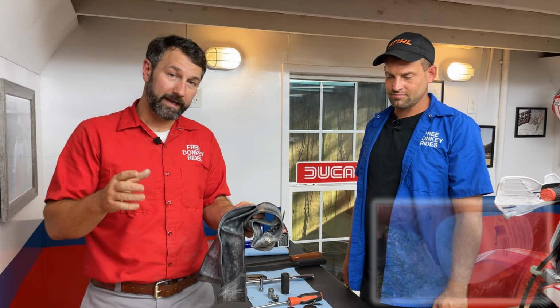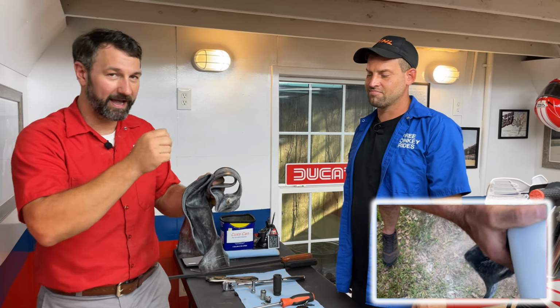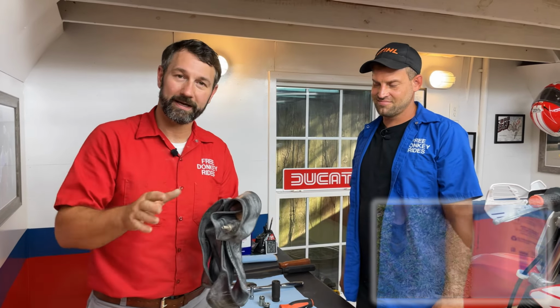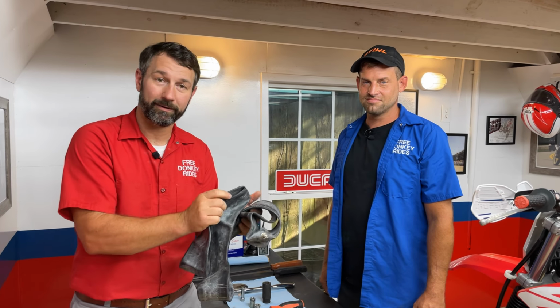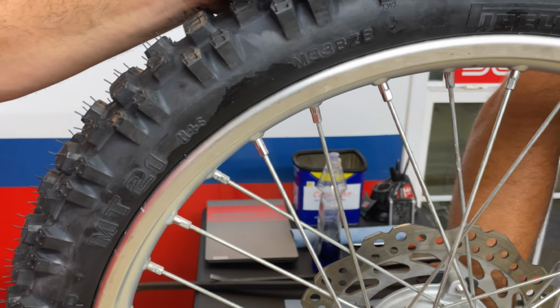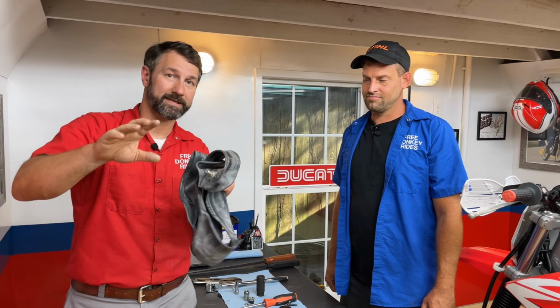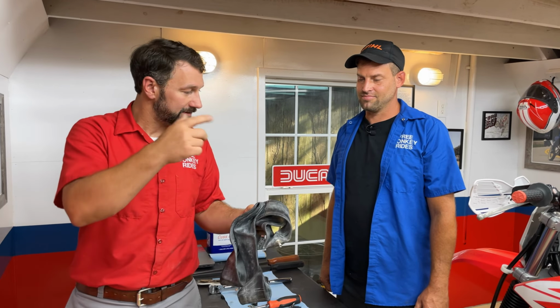And the baby powder that we got, we're going to soak it down. Put baby powder everywhere. Have some love. Yeah, have a good time with it. The more you put on, it's not going to hurt. It's going to help the tube slide around. And when we put it in the tire and we air it up, it'll seat. Plus, if we happen to touch it when we're getting it together, it'll be less chance for it to actually pinch and just kind of slide out of the way. So let's go ahead and get started putting it together.